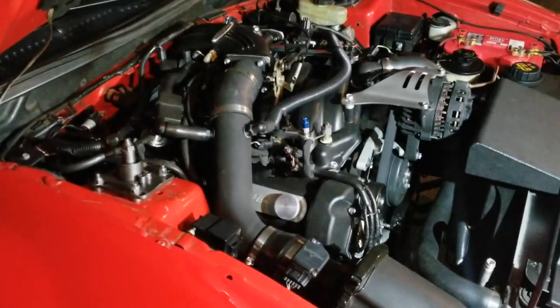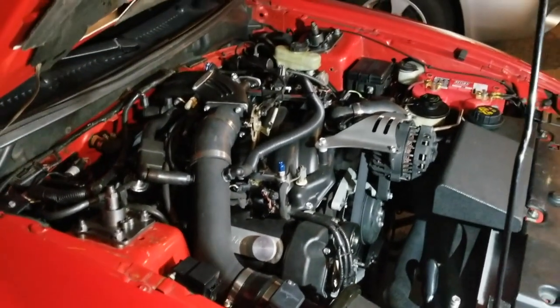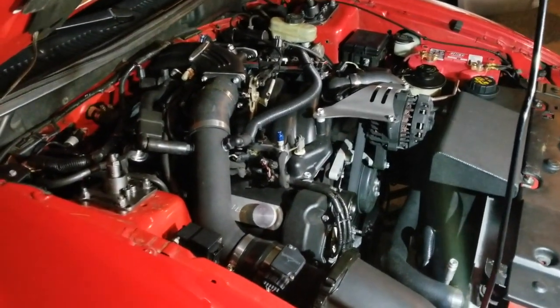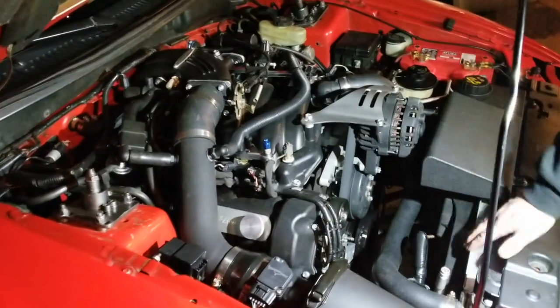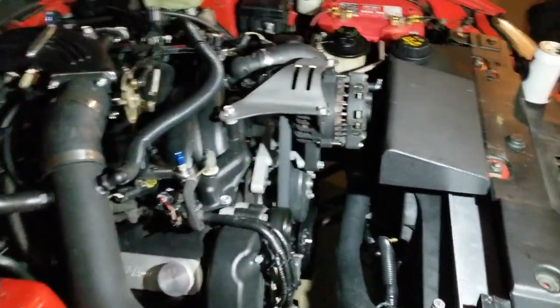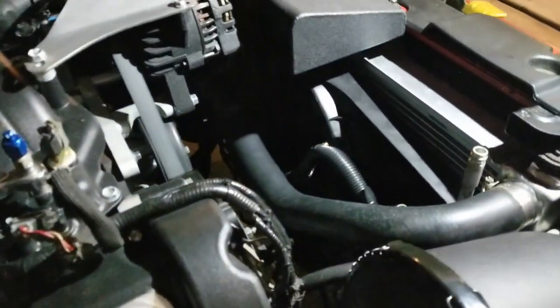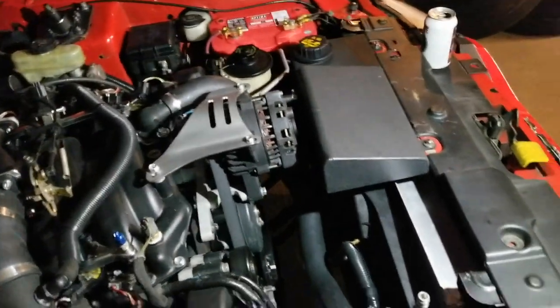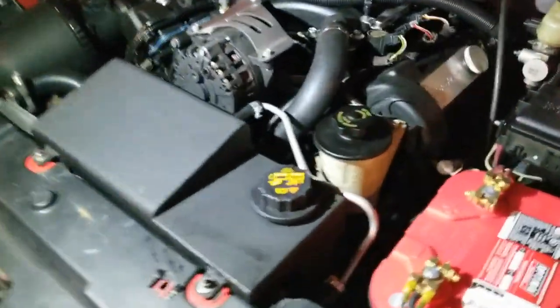Street Burner intake, like I said, 75mm throttle body by Trick Flow. It's got Coyote injectors in it, adapted. It's got the aluminum radiator, underdrive pulleys, aluminum expansion tank, Optima Red Top. For exhaust, it's got long tube headers, BBK catted X-pipe for visual inspection in New Jersey. And then I just have an SRS catback that I bought off of eBay that me and you installed a while ago, so I reused that same catback.